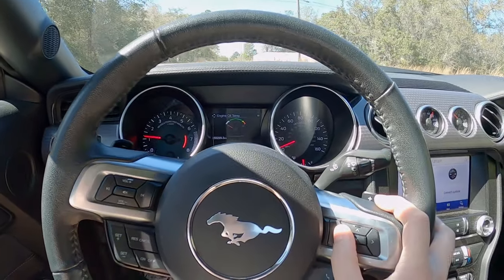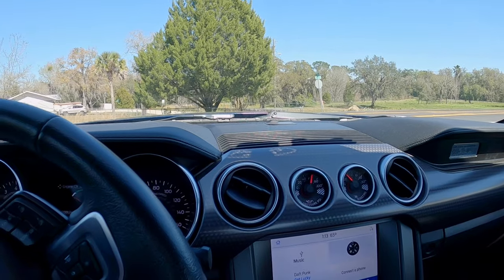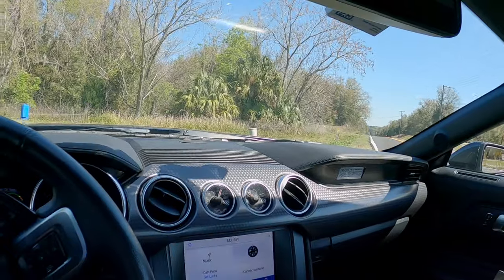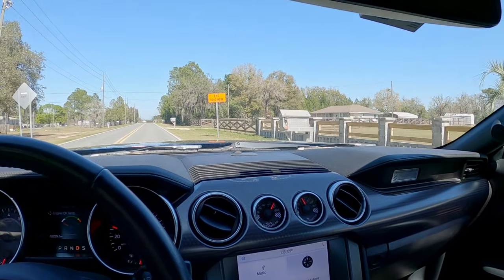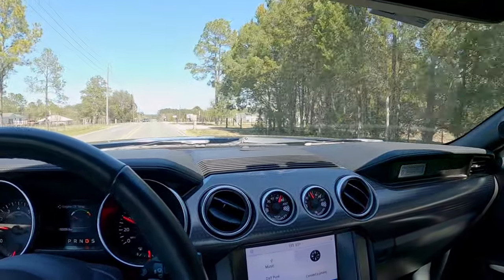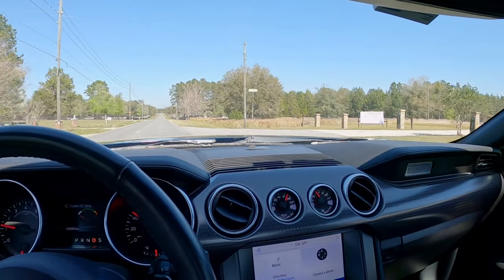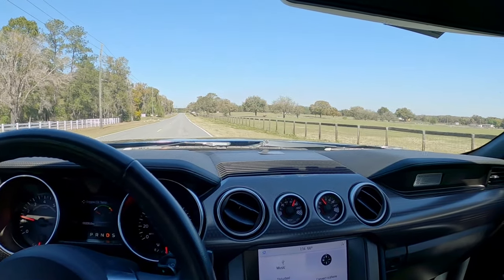Got to let the car warm up — by a little bit I mean a lot. You can hear that rattling noise. Remember when I said I had a rattling noise I couldn't figure out? Turns out it's the wastegate arm — the arm at the door that's bouncing between the hole the wastegate arm slips onto. It makes a hell of a buzzing sound. I need to find something to isolate that. Previously when the wastegate was adjusted where the door was pretty much shut with no preload it didn't do that.